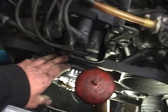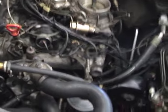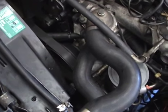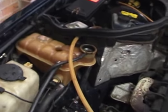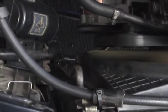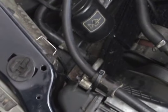My belt is starting to get a little bit worn, so I'll order another one and keep it as a spare until I get around to it. When you've got the thing back together again, put some water in it, start the engine, add more water as you go as it needs it, and check for leaks on all your hoses and your transmission lines. That's all for today, thank you.